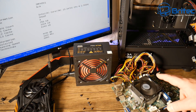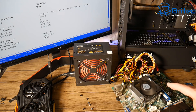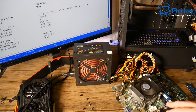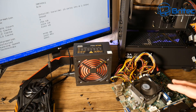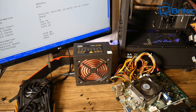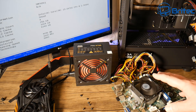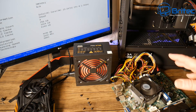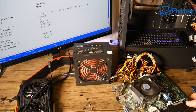To finish off - I've got this CPU in the Dell motherboard with one stick of RAM and the GPU. Put some power to it and you can see we've got display on the screen, which tells me the CPU is working perfectly fine and the Foxconn motherboard was dead on arrival. The motherboard is bad. For those people who make videos saying it's just the connectors - clean the connector on the back of the cable - those videos aren't much use here. You need to do a full troubleshooting diagnostic process, check each component, tick it off - RAM good, GPU good - right the way through until you find the problem.